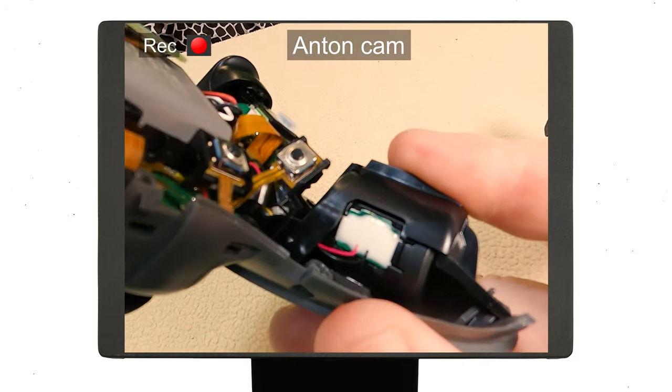One thing I did find: everything in here is very high quality. The solder jobs are good, the ribbon cables are high quality, everything about this controller is high quality. Is it $400 high quality? I'm struggling with that. But I wanted to see what the inside of the controller looked like, what components were the same, what were changed, and what the future options are. I can positively tell you that if you got a SCUF controller without clicky triggers and wanted them, you can go on Amazon — I'll put a link in the description to the same clicky triggers that are on this controller and they will fit. The thumbsticks are also swappable with Extreme Rate swappable thumbsticks. The trim pieces could be swapped with modification. The back shell you will never change, because this is a SCUF proprietary back shell required for the back button features. Overall, I hope you enjoyed the discovery process on this video and we'll see you again.